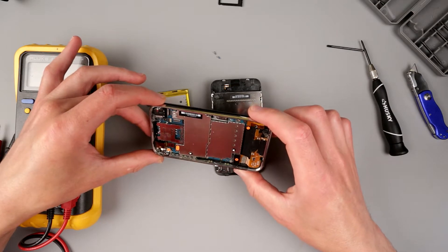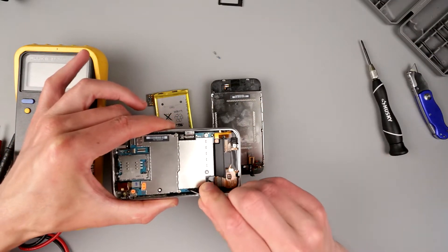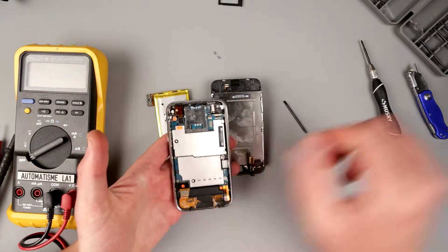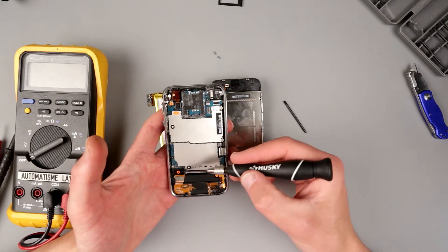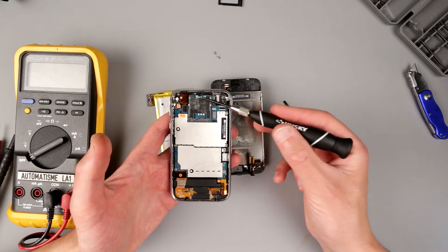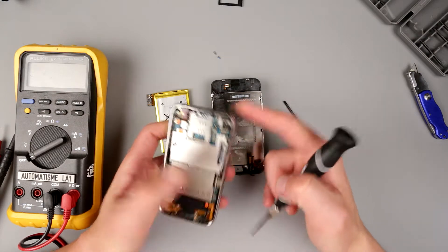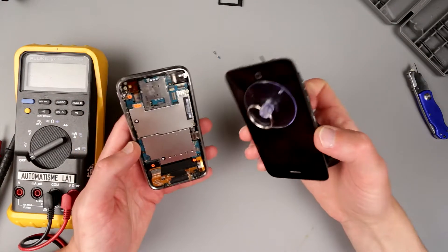We have a little bit of crud, so it has to be cleaned up. The cans are not soldered — let me poke around here if I can lift this can. From what I see, there are two big cans, a speaker, and a charging port on the bottom, all connected by this flex, and it's very nicely numbered — six, five, four, seven. The SIM slot is over here obviously. The display is underneath. In order to take a look at the display, I'd have to pull all this goodness away. There's a button over here and the camera right there.